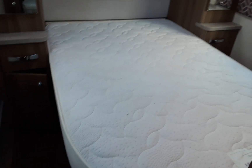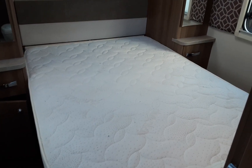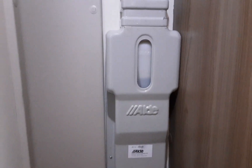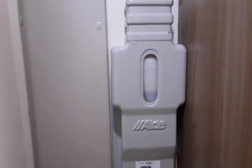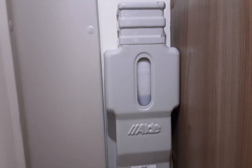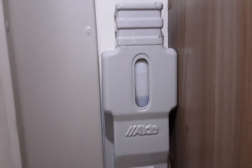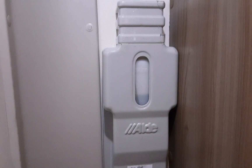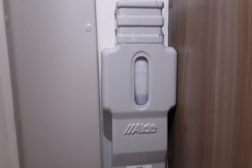The bedroom is very simple. The bed lifts up so you can access the storage underneath, and in one of the cupboards at the back you will also see the Alde heating hot water tank. As long as it is just above the minimum the system is okay to run. It's when it drops below the minimum that you need to top up the antifreeze for the Alde heating hot water system — for that just give us a call and we'll advise on what fluid to use.